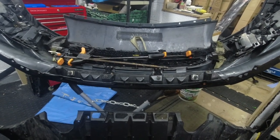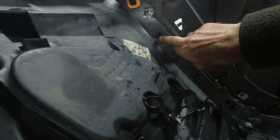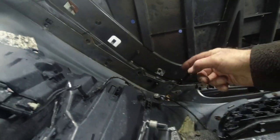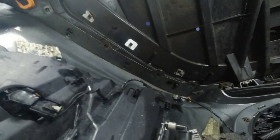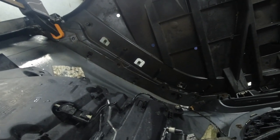To make this easier I can mark on the back of the splitter where these holes are. These clips just clip on there and give you the bolt hole. I've popped them all off these points here, and the little bits down the edge that were screwed on with these things just pop into those holes - I've removed those too so I can use them to give more stability. I'm going to have one, two, three, four, five, six, seven, eight, nine places to secure the splitter. I've popped it back on using four bolts, lined it all up and marked it up, ready to start drilling the holes.